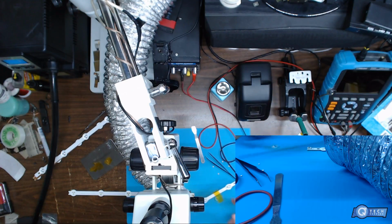So yeah, you can actually find a video on YouTube how to remove these strips from the TV. They're actually glued down to the back adhesive, and I tell people if you're gonna replace these TVs, sorry, my bad, even with the adhesive back sticking back on the actual panel itself, when you're putting the TV back, you're going to want to put some Kapton tape here, by putting Kapton tape in the center underneath the panel. This is heat tape, so it'll stick and it'll last for a while.